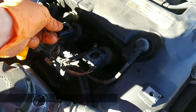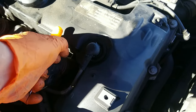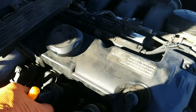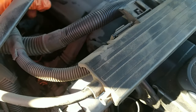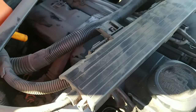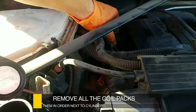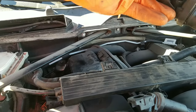A cool trick — use the pick tool through the coil pack, support it on both sides, and pull straight up. You can also use a flat blade screwdriver. Be very careful not to pull on or damage the wiring. You can wiggle the electrical connector off each coil pack or use a small flat blade screwdriver to separate it. Remove all the coil packs and line them up next to the cylinders they came out of — that way if you had a misfire you know exactly which cylinder it was.